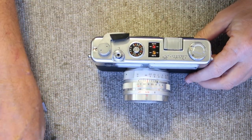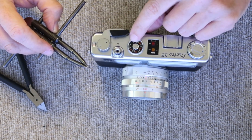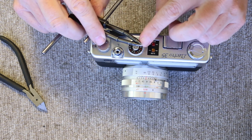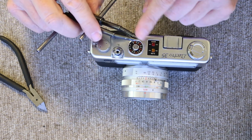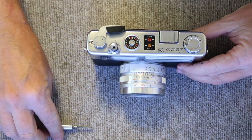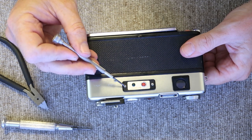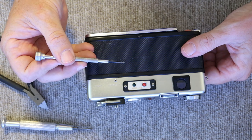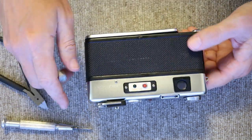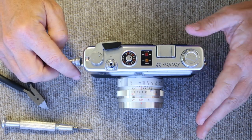The tools we need for this job: we need a pointed spanner like this one. This is used for two things — to remove the cap screw off the film winding lever, and this other cap screw which goes around the film speed adjusting dial. If you don't have one of these tools, you can make one with a pair of tweezers which have been sharpened to points at the end, or an old pair of needle nose pliers which you can grind sharp on the tips. We need a Phillips head screwdriver to remove the screws holding on the top cover, and a slotted screwdriver to remove this cover for the battery check lamp. If you have a later model Yashica it will be held on with Phillips screws. This is a mid-range one that uses a combination of Phillips screws and slotted screws. The first generation uses all slotted screws; the GTN and GSN use all Phillips screws. But otherwise the same process for replacing the POD applies to all cameras.